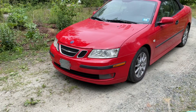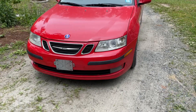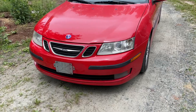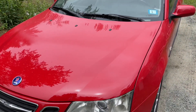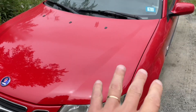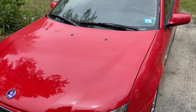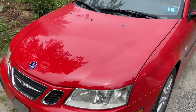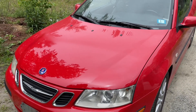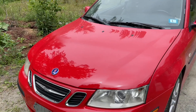Here it is — much, much improved. Looks so much better. I haven't done any of the buffing and blending yet. I probably should have just prepped the entire hood and cleared the whole thing, but I don't think I'm going to have any trouble cutting it in and buffing it all out. I was really trying to avoid going too far — I only wanted to do a quick job to fix up the clear coat and not end up repainting the whole car.